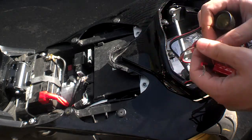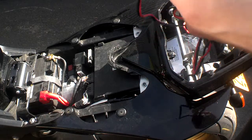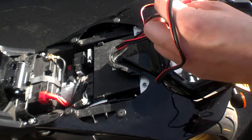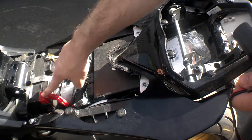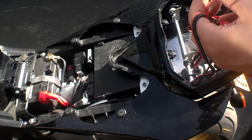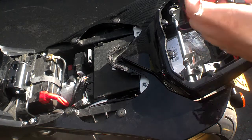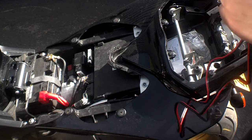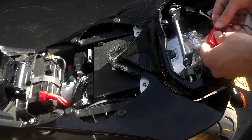What I wanted to do was put it to the wires that only provide power when the bike is on, but for ease of install I just hooked it up straight to the negative and positive ports on the battery. It's really easy — you just cut and splice the two wires that go from the alligator clips and just feed it through. I'll go ahead and demonstrate how you feed it through.